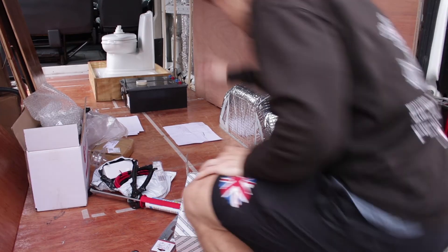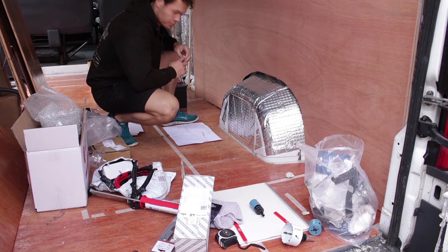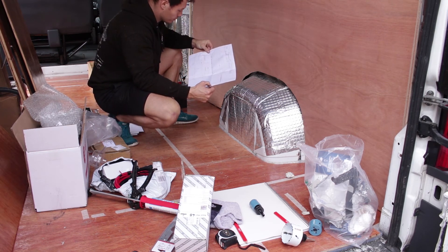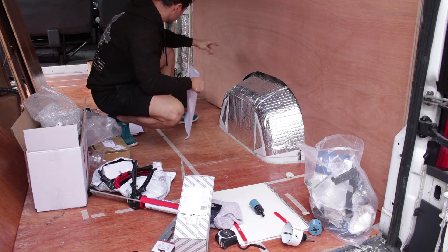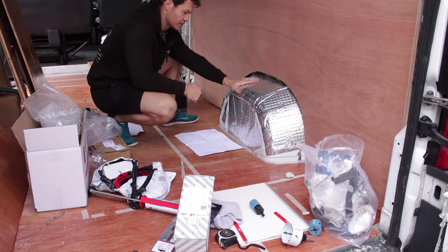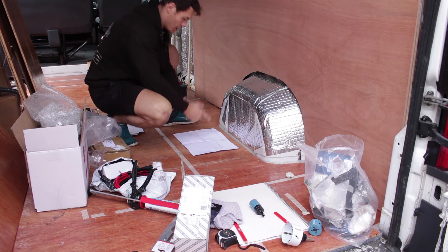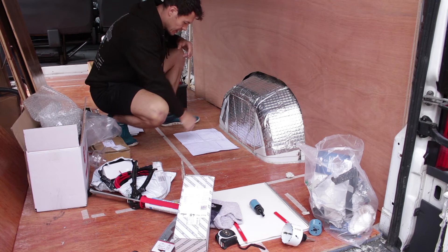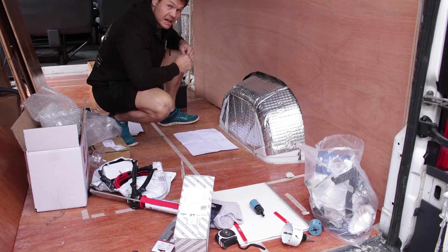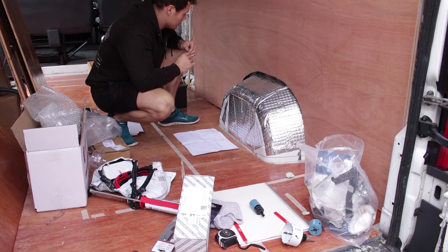Excuse the mess — I'm trying to do lots of things at once, cutting all the holes in the van. I have a Propex heater and they kindly provide a template for the holes. I'm directing the air and hot air away from the batteries, and it means the vent holes can be a little further in towards the van so I'm not dealing with chassis members. I'll go under the van with the template, drill in with a 3mm bit through the template holes, then use the hole saw to cut through from inside and hammer it out. I wanted to get the heater in and all the holes drilled before starting the furniture.